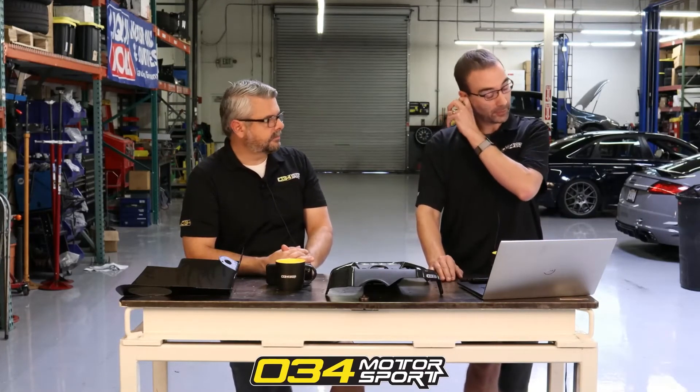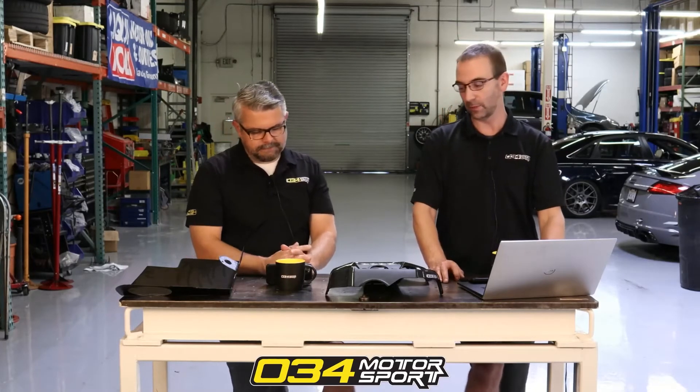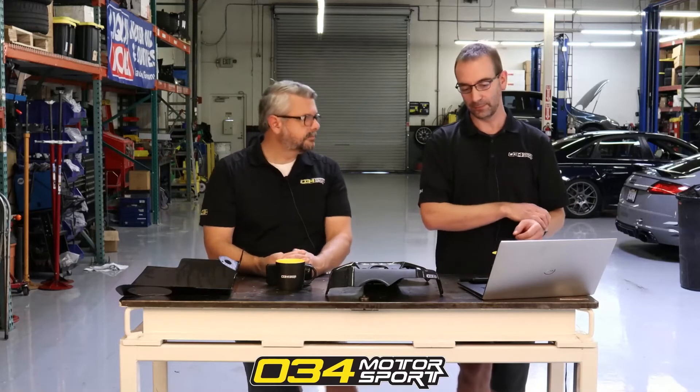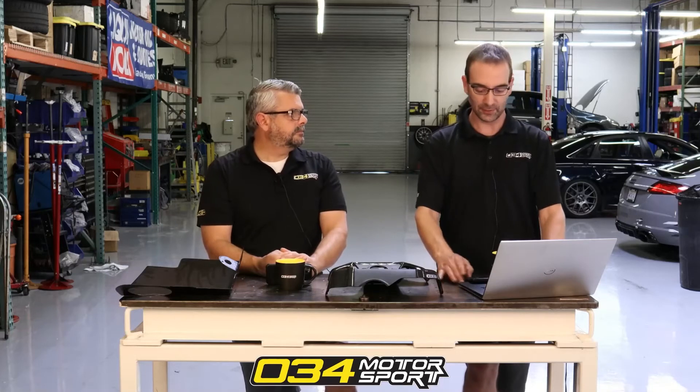We recommend repinning it for basically any throttle body that's out there. We've supported the ultra charger style for a while now, but it's becoming more of a headache to deal with — it's just so fussy to do it the way they did it. We've got guys where it's working fine, and the exact same file, the exact same ECU, it's nothing but problems for another guy.